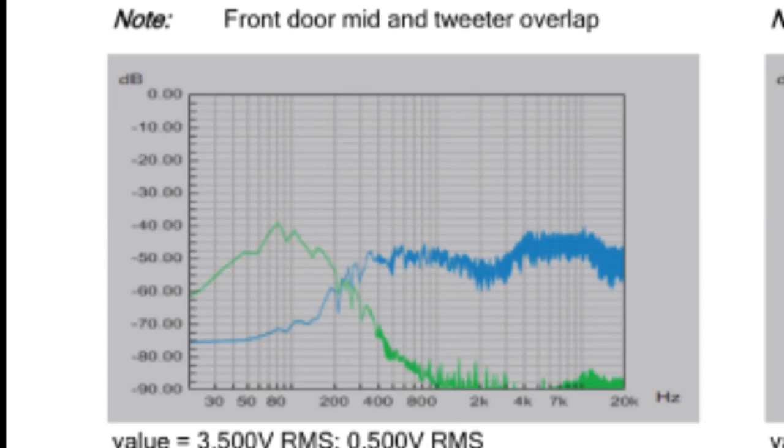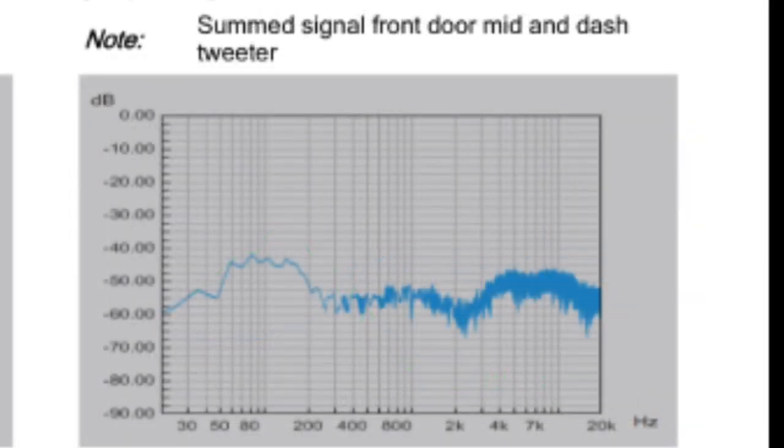Now in this diagram here, I used a dual trace oscilloscope — I showed the door speaker in green and the dash speaker in blue, showing the two where they overlap, both at the same time. Then we go ahead and sum those signals. This graph represents the summing unit — basically the front door speaker and the front dash speaker. We took those and ran them into our Audio Mobile LDV6, and it summed the two together and gave us a full range signal. Then we ran that into our amplifier, and out of the amplifier we ran it to our crossovers that come with the manufacturer, so they get the correct signal they're intended for. We actually sell the Audio Mobile pieces on our website, so you can check those out if you're interested in the summing unit.